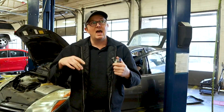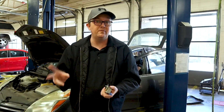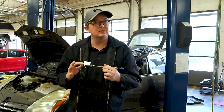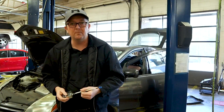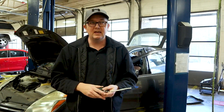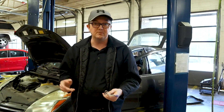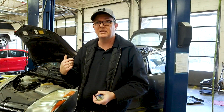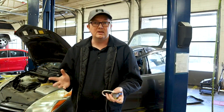The car came in with a C1252 code, which has to do with an electrical fault in the pump, and that could be caused by this resistor. It also had an accumulator leak, a C1256, and a C1391 — definitely two codes that say your pump's bad. But before we send this thing back out onto the streets, we're going to replace this resistor as well, just to make sure the pump is protected and we don't mess up the new pump.